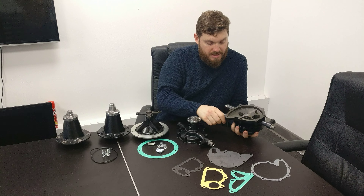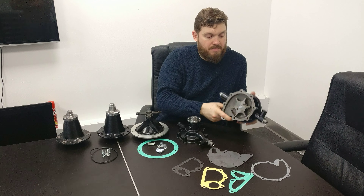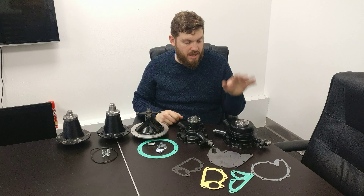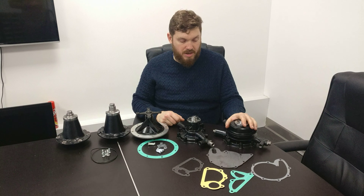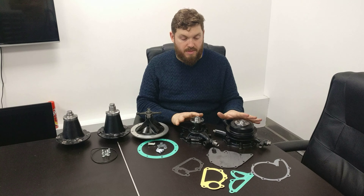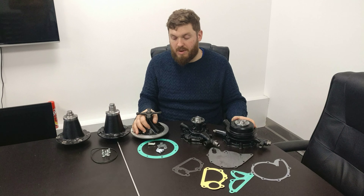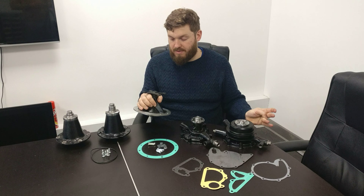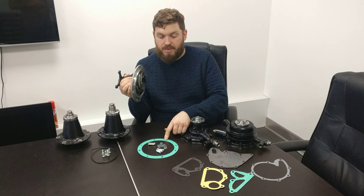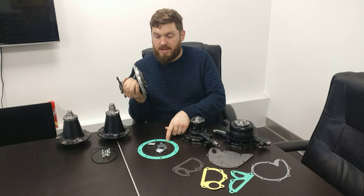The reason why you should go for a new water pump — we also offer reconditioned ones — is that a lot of the time these rotors are just rusted thin, not much left of them. They can get broken when they're pulled off. The housings can be rusted through, and these threaded areas can get corroded away. Also, when we do a reconditioned pump, we charge a surcharge to get the old one back. So these are available brand new off the shelf with no surcharge.